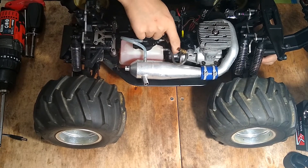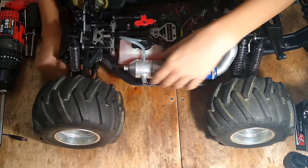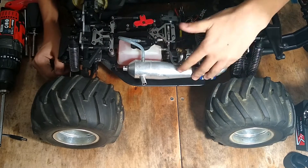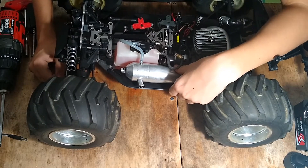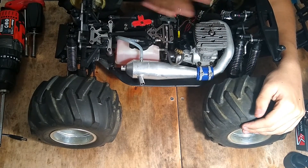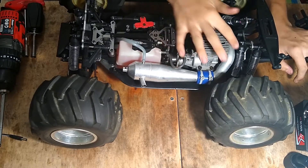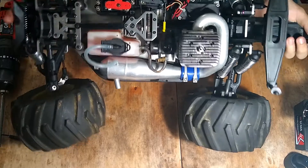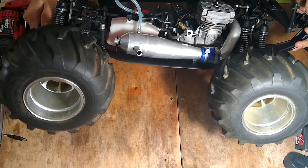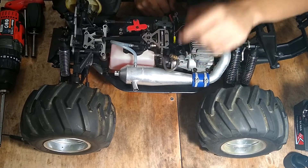The clutch is a little bit blued out, but it's free and not seized, so that's good. The exhaust is really clean — there are a few stains around it but that's to be expected. My Webra 35 engine muffler on my Quick 30 RC heli was coated and I had to use a wire brush plus WD-40 to scrape it off, which took me an hour. But this exhaust is really clean, and the engine block and crank case are really clean too.